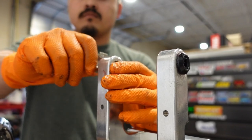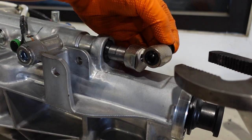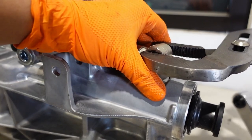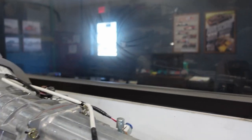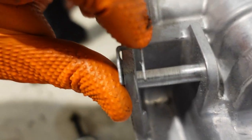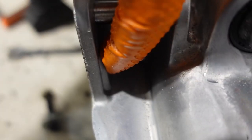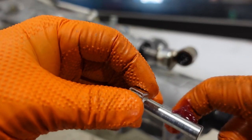Now you can install your OEM shifter pin bushings into the shifter flex coupler. These are also not included with the new transmission and need to be purchased separately. Use a large pair of channel locks to carefully press them into place — don't forget to add some grease before pressing them in. The OEM shifter base pins are side-specific; there is a small locking tab that engages a piece of casting on the transmission case and locks into place once the shifter base is installed.